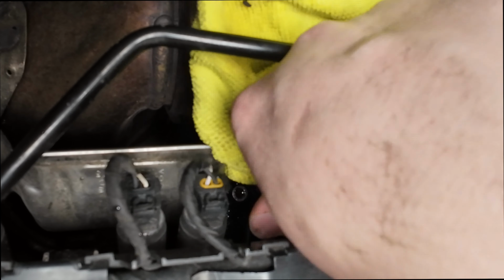Right, so now these are the coolant fittings. This is the one I just took off the car. You will note plastic with a very, very, very flat O-ring and a decent chunk missing out of it. Now, I noticed this when I was looking at it earlier that this had been missing. You can see there's a lot of oil residue down here too, so clearly it had been missing for a while. But I don't think that was why it was leaking. I think it was because of this very, very hard and very flat O-ring.